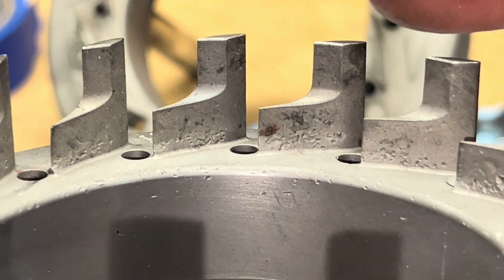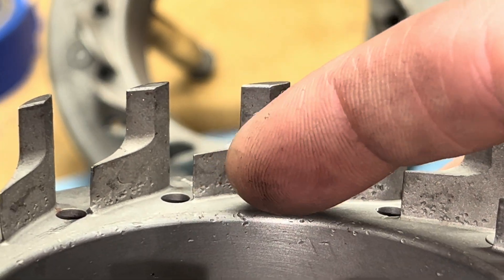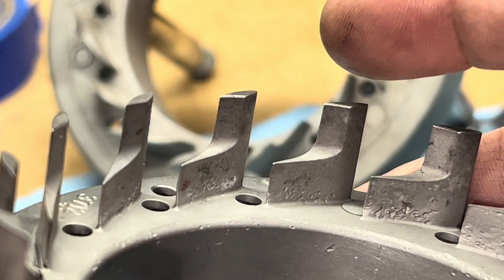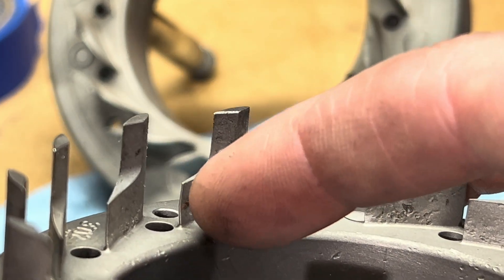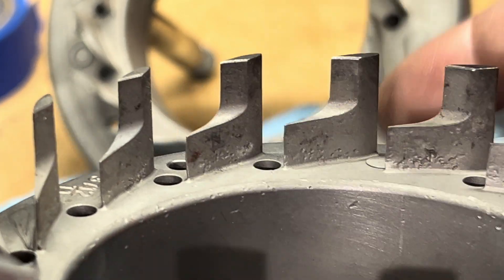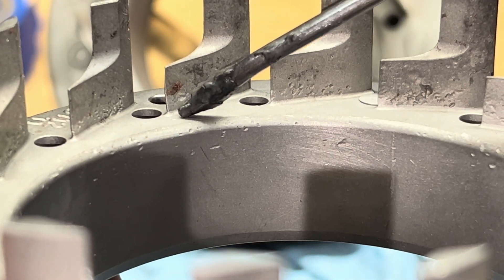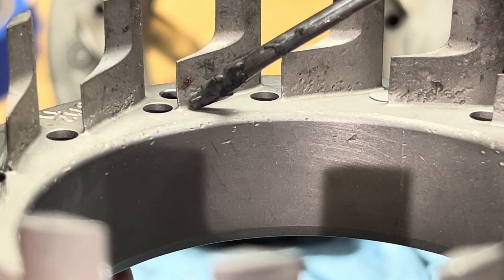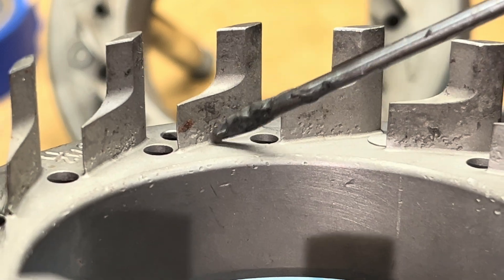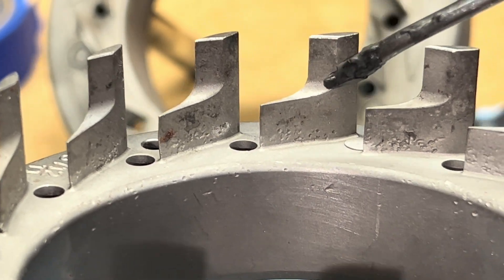The thing I'm looking for here — you can see it's got all these little damage marks here that are sticking out, and the blades are actually bent a little bit right there. I also look for cracking on these. It's very common that they can crack right at that edge right there, especially if they get really hot. Even if this whole thing is still good, it can start splitting right there if it gets really hot and start sticking.